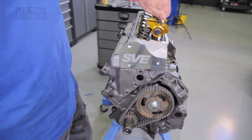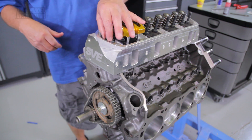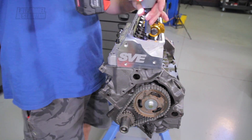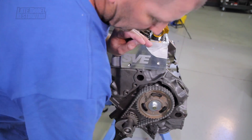Position two roller rockers onto the guide plate and pushrods. Tighten your roller rocker set screws to zero lash — zero lash is achieved when you can just barely turn the pushrod with your fingers. Whatever cylinder you're working on, snug down the four cylinder head bolts or studs surrounding that particular cylinder. Now make two full rotations and return the crank to the 12 o'clock position.